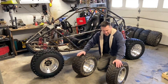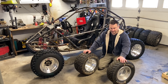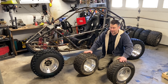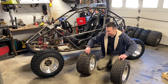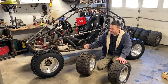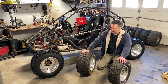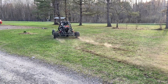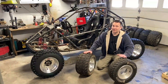These are the race-sanctioned tires — the Hoosiers. Maxxis also makes cross cart sanctioned tires. They're pretty soft compound and these suckers hook up. The tread isn't that aggressive as far as the lugs, but the rubber compound — these are like winter tires, super soft, they just grab everywhere. These will actually tear up my lawn more than big lug all-terrain tires. If you're looking to hook up and tear up stuff, these are your choice. You can still drift on them but it takes a lot more right foot to get them churning.